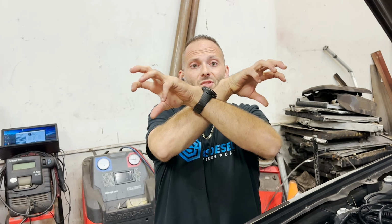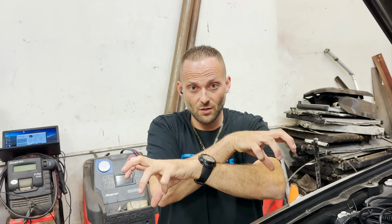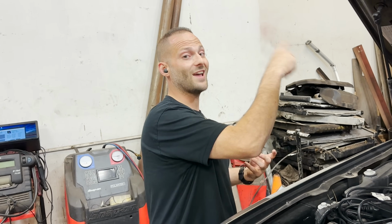Now we had three selections, tow, street, or performance. It's going to select the tow and it's going to put that into the truck. So now the device and everything is married. If you want to change that, you re-sync all this up and take the tow out and put the performance on. If you don't want it on your truck, you take the tow, street, performance off, and then the stock file goes back in and it is unmarried, ready to use on four other trucks. You can't go and put a tow one in this truck, take it off, and go put the performance one in that truck. That's not how it works. Once it's married, once the stock file is out of the truck, it has to be put back in order to go to another truck.